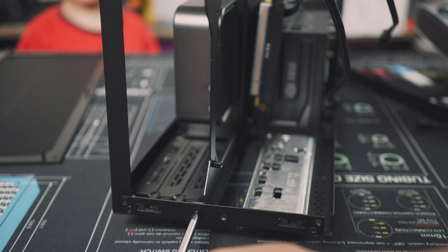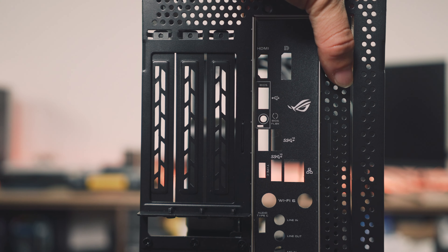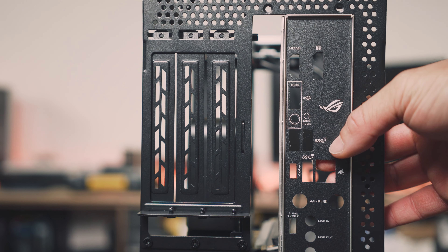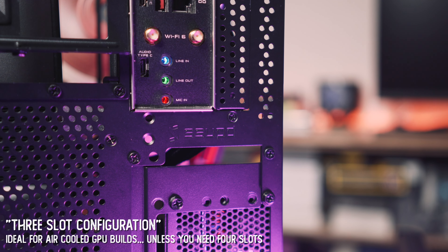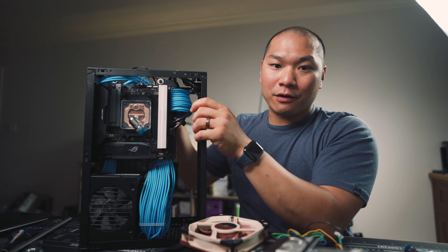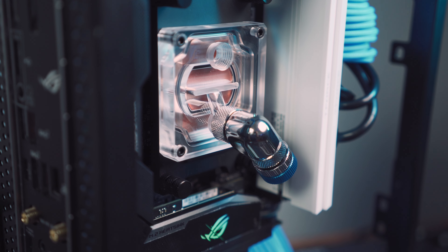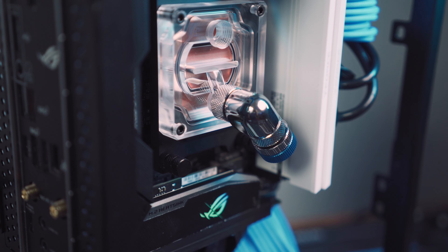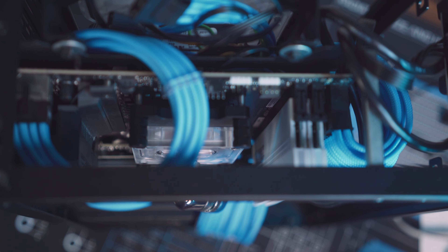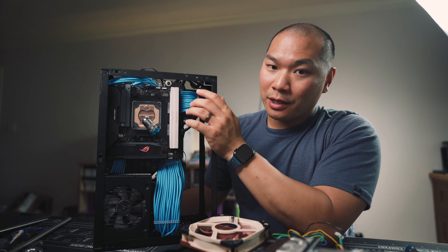To do this, you'll loosen up the screws holding down the case divider, remove the cover next to the motherboard's IO shield, and then just shift the whole divider over. There are quite a few screws, so take your time, make sure everything is unscrewed, and then you should be able to unlatch it. With 53 millimeters, you should have more than enough for your typical CPU water block and a G1/4 elbow. I've got the Alpha Cool fitting and the Optimus AM4 block, and it's just about flush with the front. You're definitely going to need either a hard line bend or a 90-degree fitting to get out of this tight area.